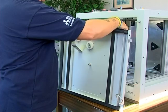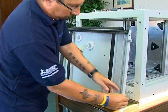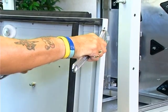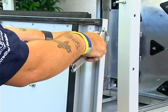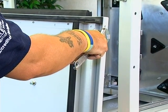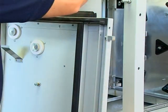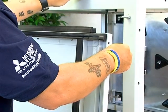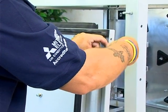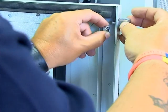First remove the sealing strip, then remove the grommets and put them to one side. Then remove the hinges from their existing location using adjustable spanners and relocate them in the two holes from where you took the grommets, making sure that the pin location hole is pointing downwards. When this is done, refit the grommets in the holes from where you removed the hinges.